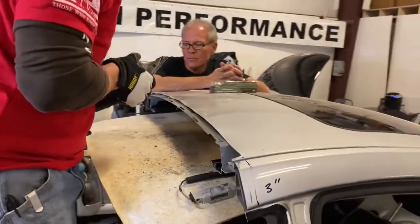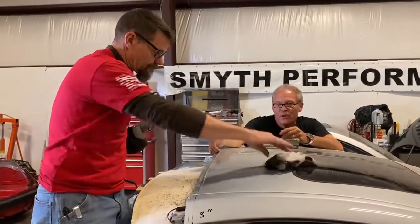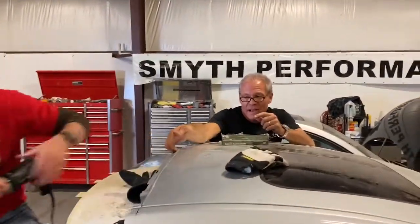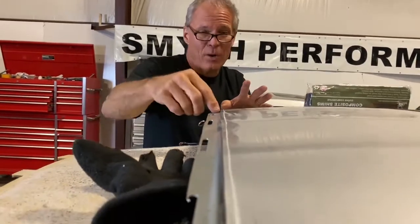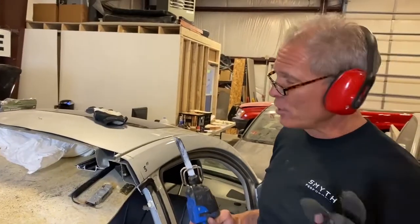Now we're back to the Sawzall to take off the corner pieces. Remember, the skin here is very light. You're going to be putting fiberglass — the leading inch of the fiberglass rear surround is going to tuck under here. This is kind of self-smoothing. You put a couple of rivets or screws in there while the panel bond cures, and when it finally cures it's pretty much forever. That panel bond is amazing stuff — it really anchors this down, and this little lip keeps the panel bond trapped so you can bulk it up.